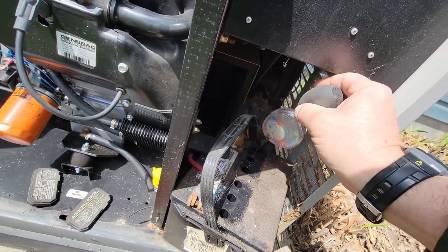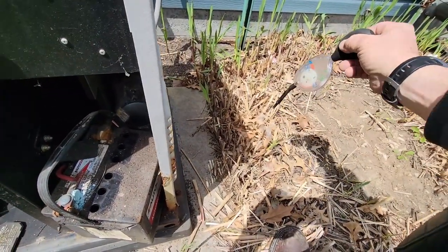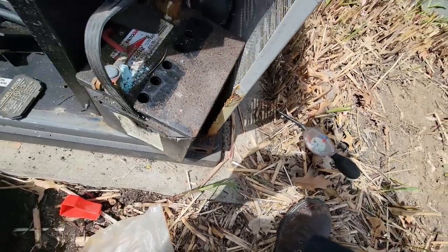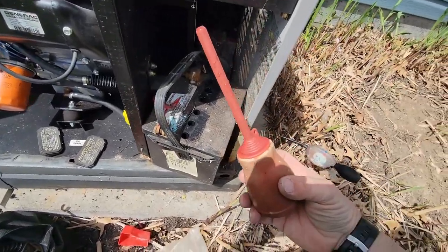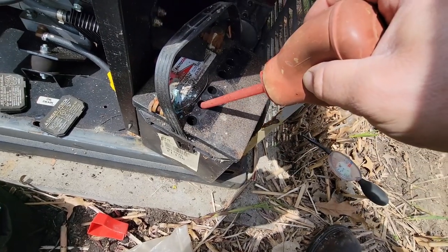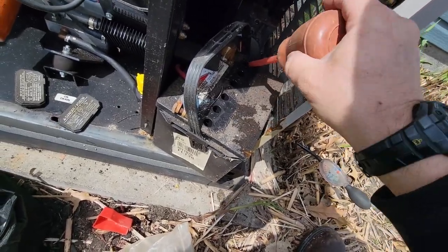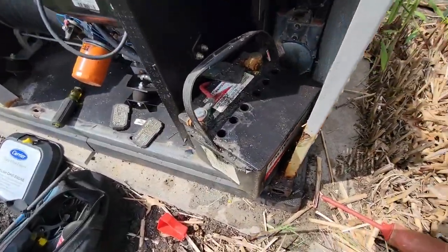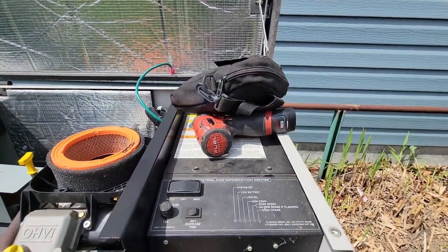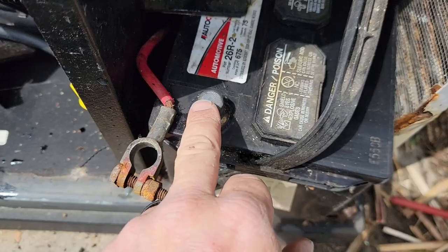About 1300 with the water level all the way up. You want to make sure you rinse your gauge out - you don't want that acid getting on anything, so I always rinse that out after I'm done. We'll go ahead and add some water using my little dauber here, get that up to the bottom of each one of those plastic rings. I'm going to need to grab another one. Got the water levels up. I'm going to clean this up a little bit, then grab my digital tester and check how the battery fares on digital testing.